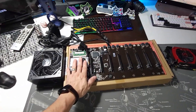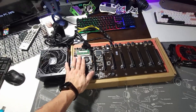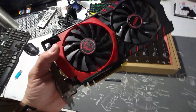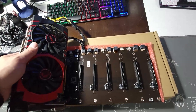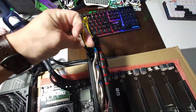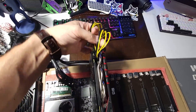With one GPU plugged in I hope it will work, so we'll find out in a little bit. This is an MSI R9 380, a four-gigabyte card — not much, but I use it for testing. I was trying to get rid of this card but decided not to. We're going to take it and plug it in — it fits nicely. So we have our GPU on the motherboard, and I'm going to connect the power cables to it — one and then the second one. There we go, two cables using the splitter.